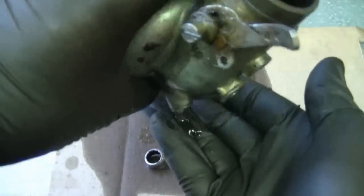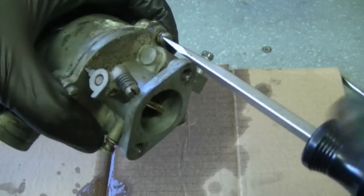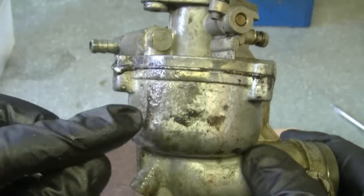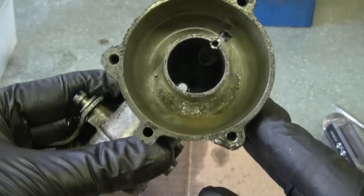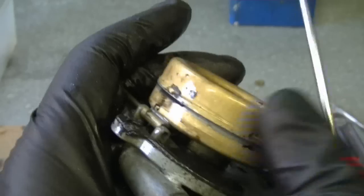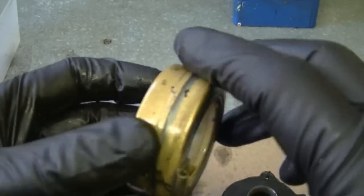This is a fairly long jet that's going to come out. Now I'm going to take the top screws off — there are three of them. Once the screws are off, you need to separate the top part of the carb from the bottom part. Sometimes it's stuck on from the gasket; if that's the case, just gently hit it with the back of a screwdriver. Here's the inside of the carb — there is a bit of corrosion down here. Now I'm going to take the float off; to do that just push the pin out. Now I'm going to shake the float. If I hear fuel in the float, I know it needs to be replaced. If you don't hear any fuel inside the float then it's good. I usually do this by my ear, but if it's a big float like this you can usually hear it even if it's not held up close.